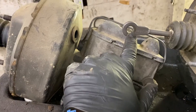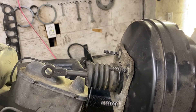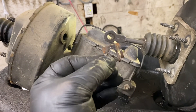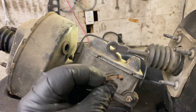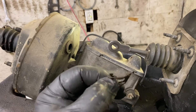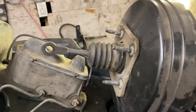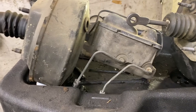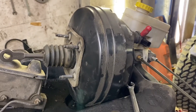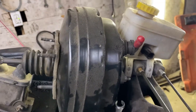A couple of things I'm going to measure: see if that diameter is the same, because on the pedal there's a bushing and it's obviously got to fit over it or it's not going to work. This is the clip that goes over the rod. There's that little tab right there — you have to push that up and then slide this off. That's a locking tab that keeps it from sliding over the ball on the end of the rod. The nice part is all the wiring for your brake lights is on the pedal itself — it has nothing to do with the hydraulics. So as long as the pedal still functions, you shouldn't have a problem with rewiring the brake lights. It's just the warning light for brake level and hydraulic pressure that is going to be an issue.